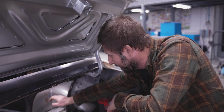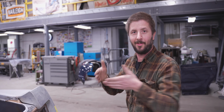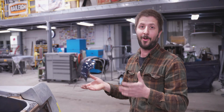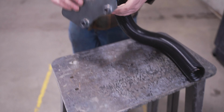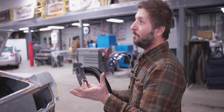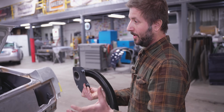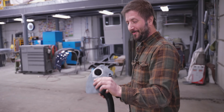On the other side of this, on the very bottom, there's a 2-inch tube, so it goes from a 2.5-inch tube to a 2-inch tube. Going to a smaller tube will kind of speed up the air as it passes through. It's kind of like a jet effect. Plus, there's not a whole lot of room under there because he wants to run 3-inch exhaust all the way out the back, so that robs a lot of room around the axle. So the tube comes out and goes in between the 4-bar setup, and then it goes into this piece we fabricated. This will bolt to the caliper bracket.